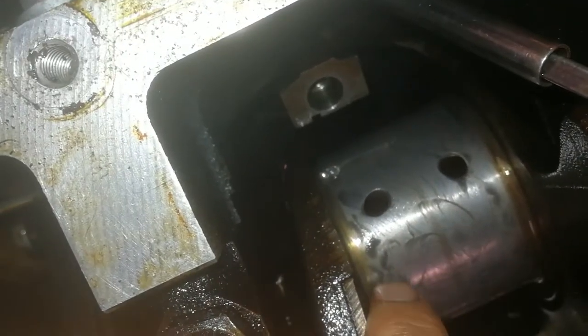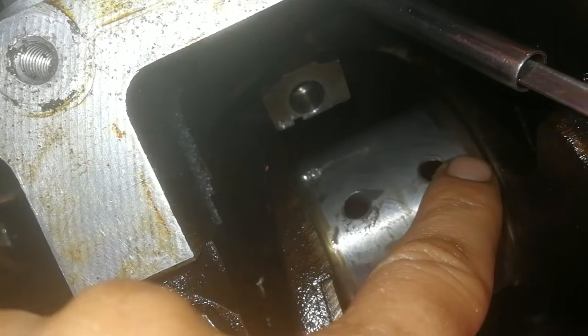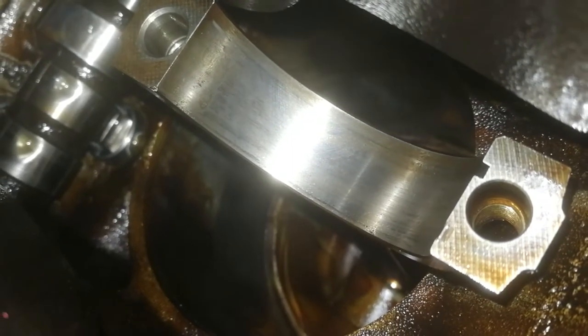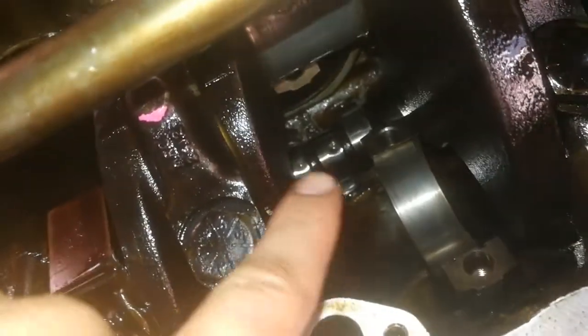You can see it's taken a thin layer off. Now I'm going to blow air up these holes on the crank journals. I've sanded that surface down a little bit — might give it just a little bit more. I'll turn the crank and get number five sanded a little behind there.